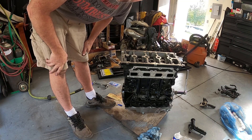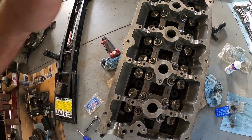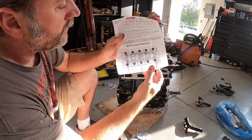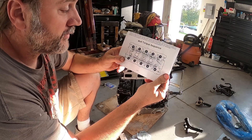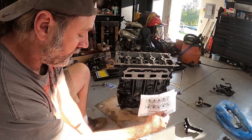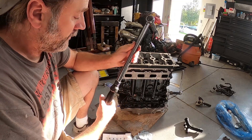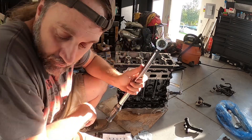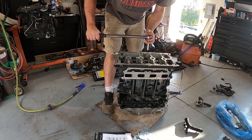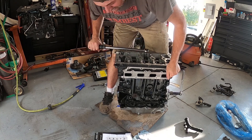I'm going to get a ratchet and go over all of these nuts to get them tightened down. We have our torque sequence — the way the cylinder head is, I've actually done 45, I did 65, and right now I have it set up at 85, which is our final torque spec. We're going to start at number one — I'm a little scared I'm not going to be able to pull on this thing.